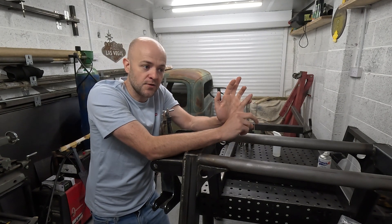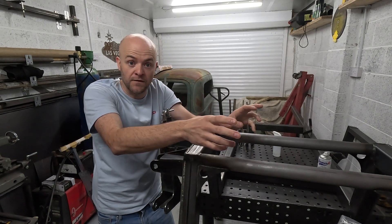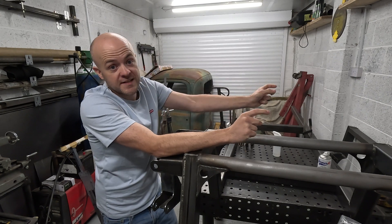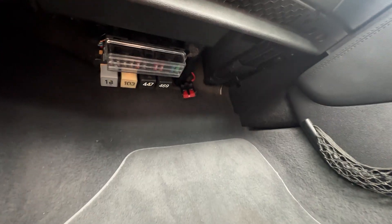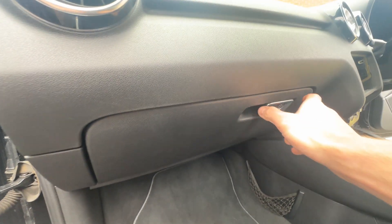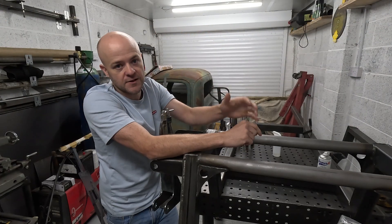On the Fabia side you only really have the CAN going to the power steering and the CAN going to the OBD port — which is a separate one for the Fabia. I run two OBD ports: one is the engine management one, which I've located in the glove box, and then the A1's original one is still in its original area in case any faults come up with windows, lights and so on. If any engine management faults come up, I can read the one in the glove box.